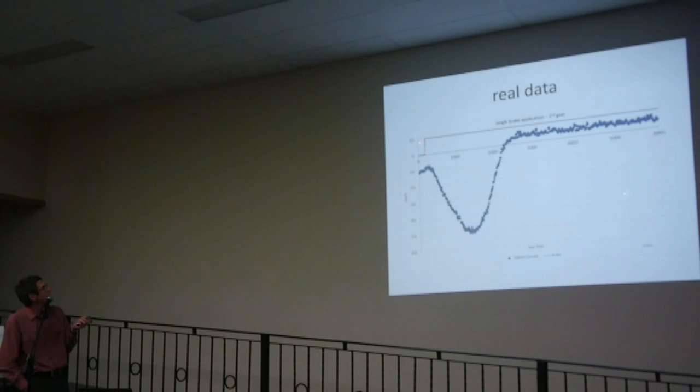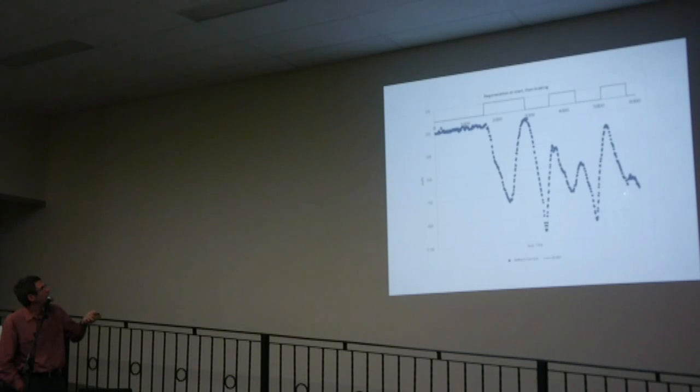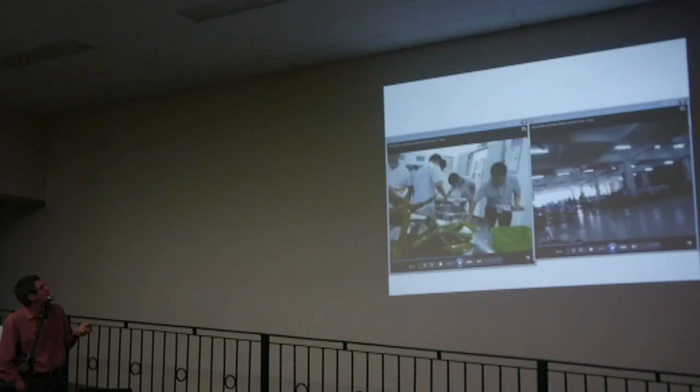The application of the brake is just this point here, and that reveals a regeneration current taking about 2 seconds, with a peak of about 50 amps, which is pretty believable. Another one was two applications, one after another, over about 2 seconds, going back to about 70 amps peak. Then coming down a longer hill with constant application of the brakes on and off, and we recorded that sort of result.